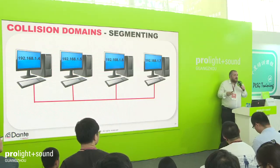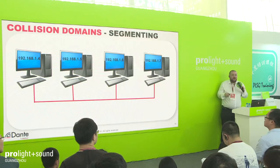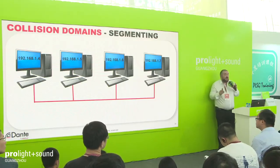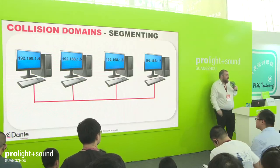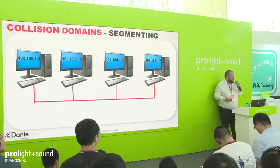Typically, if you're doing audio over a Wi-Fi system, it will be some kind of compressed audio codec. You'll still have quite a long latency, but it won't be full professional bandwidth audio. And that's exactly why. Also, the timing will probably be all over the place on Wi-Fi audio. And that's not what we're trying to solve with Dante.